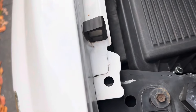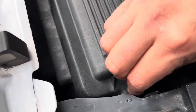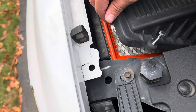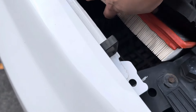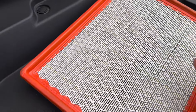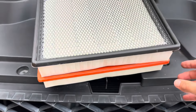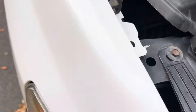Is this whole thing ready to come out? Yeah, it needs to come out a little bit more. The transfer case also takes automatic transmission fluid, so I've bought enough quarts to do the transmission drain and fill and the transfer case drain and fill. Okay, so old air filter coming out, new one going in. Same size — good to go.